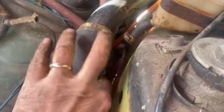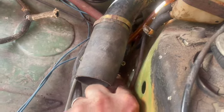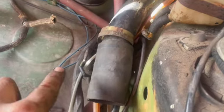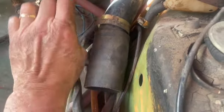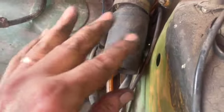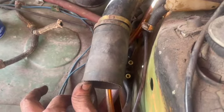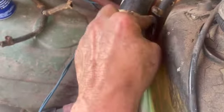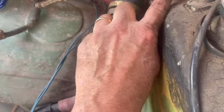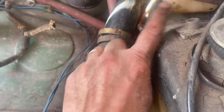Here's what we're talking about — letting the brake lines loose. The supplies that come out of the reservoir go into the floorboard down here beneath the driver's side, then come through the firewall. That's where your legs, your feet, your pedals are. You can fish and follow them around, loosen them, give them a little slack to pull them down, and when you're done you just pull them back up and tighten them. Might want to address all these fittings and see if you need new hoses.